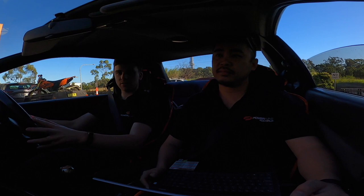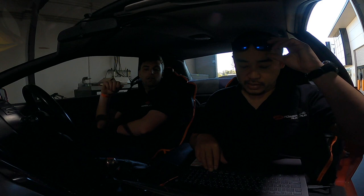So are there any takeaways from that? I can feel that the injectors on pump fuel are probably a little bit too big. Because what are they, 1650s? Yep. But it's sort of unusual now to run pump, not flex. So if we were to put a size smaller and then you decide to go flex, which I think you will, you actually end up changing the injectors again and again. So just gotta bear with it for a little bit.